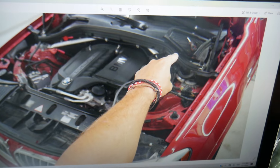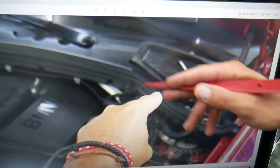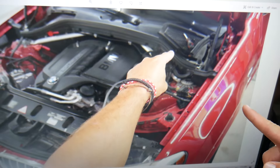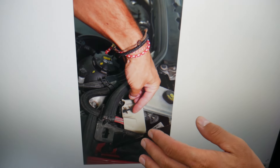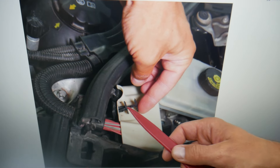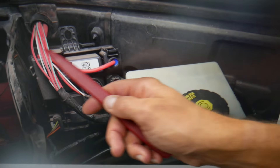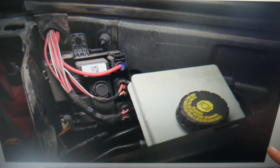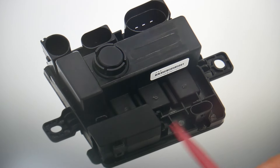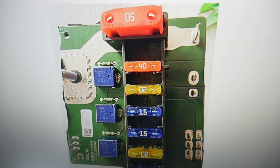Now here's where the real magic happens. Open the hood and towards the windshield you'll see the cowl trim cover — that needs to come out. We'll have a video showing how to do that in our BMW X3/X4 fuse box location and diagram video. This here is the brake fluid reservoir. That white cover needs to come out — remove that clip, remove that clip, and pull the cover out.